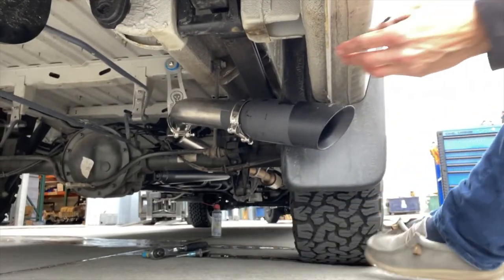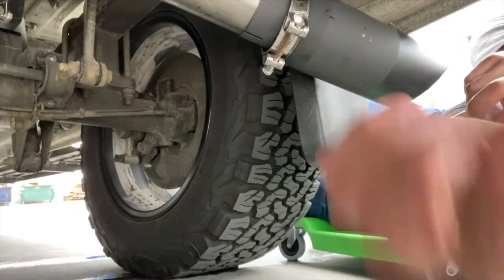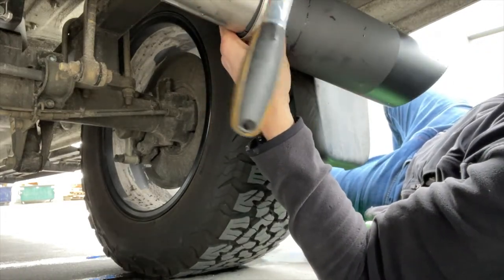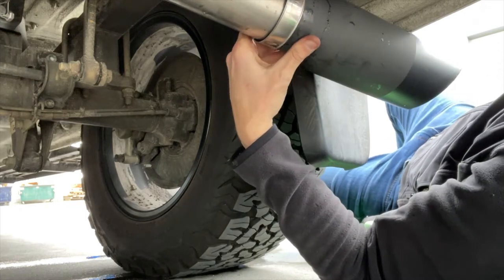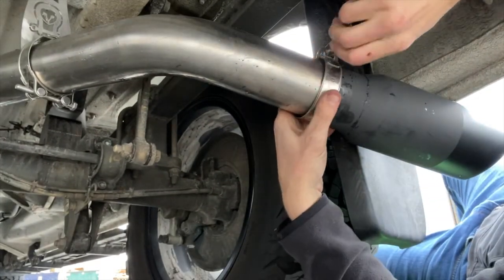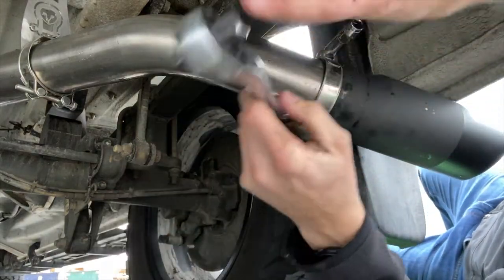That coupling is a 13. And this one you're gonna have to make pretty tight. Try to move you again. Because what you have to do is you have to collapse this part around the smaller tube. So at first you're just gonna be tightening this pretty easily. So you want it just kind of the edge of this junction with the edge of the exhaust. That'll collapse at the best and hold everything tight. Okay, we're finally starting to get that tight, so now we'll use the ratchet.